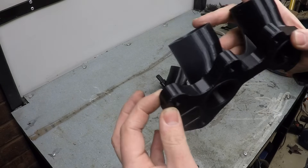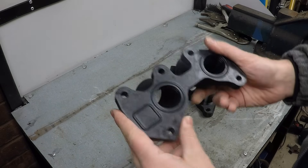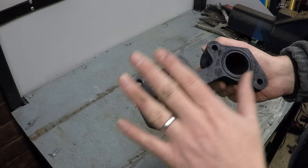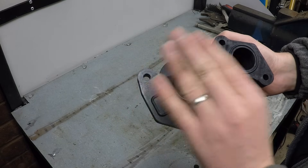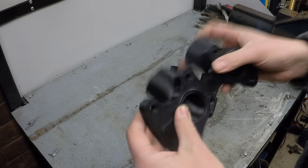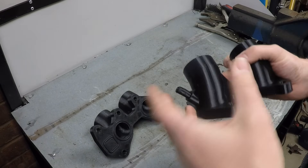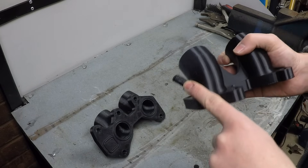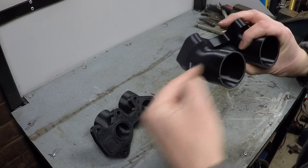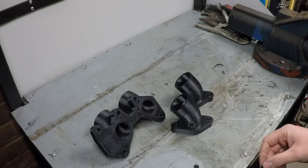I refined the design — thickened up the flange and added o-ring grooves. This is common when you see OE manufacturers making plastic inlet manifolds. They use o-rings so they don't need as much clamping force, because I don't think I'd get enough force to deform a metal gasket using nylon. It also adds compliance. I also added a vacuum takeoff for the brake servo — taking off only one runner, because all it needs to do is provide vacuum.